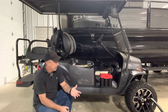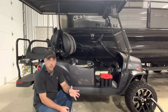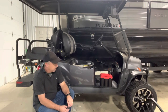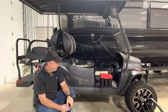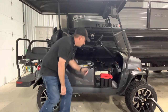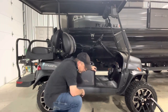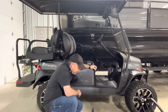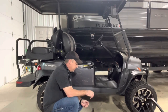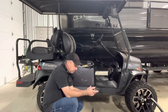The main reason I'm doing this video is I tried to find out what group number the battery was so I could purchase it, and I just wasn't having much luck finding that out. So I took it into Interstate Batteries and asked if they had an AGM. They said yes — it was about 60 or 70 more bucks to get the AGM. It was an Optima, part number SC35A, so it is a group 35A battery. The poles are reversed, but you can flip the battery around to get it right.